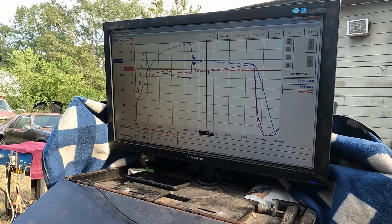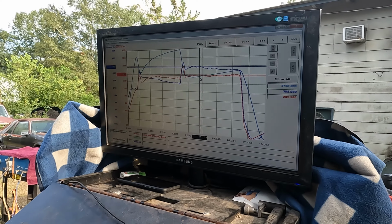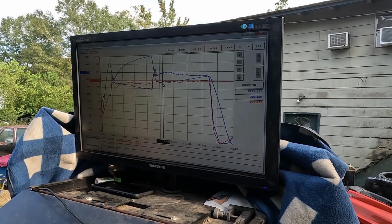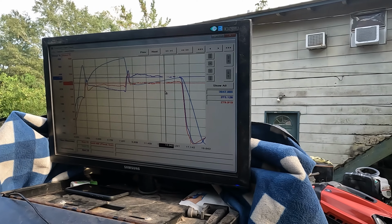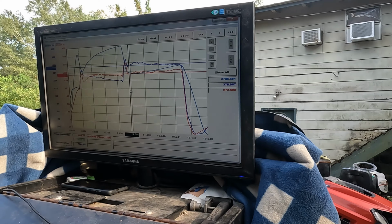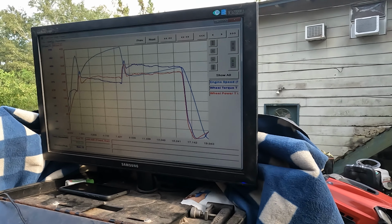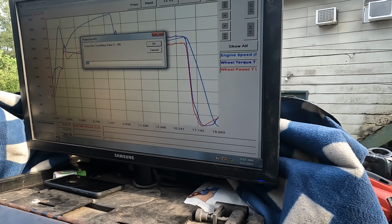Or maybe not. No, because it blends both the highs and the lows. You're right, it smooths it. So like, yeah, I'm not going to get that 419 torque spike. I got 401. Okay. It's still up from 375 factory. So muffler and tune, it still brought it up to a spike of 419 and a blend of 401. Yeah, so the damn muffler did something. I didn't think the muffler was going to do anything. I mean, it opened it up and it let some of it through.